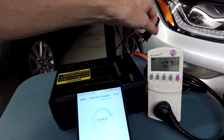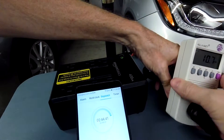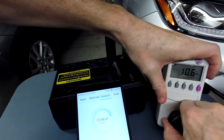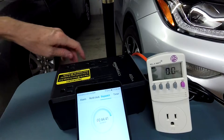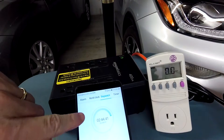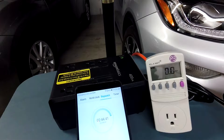Let's unplug it again and get that alarm going. With less load on the unit, I think we'll get the 30-second interval beeping — and there's the 30 seconds. It does calculate how much time is left internally. If it's probably under 2 to 4 minutes remaining, it does the rapid beeping; if you have less load, you'll get the longer 30-second beep intervals.